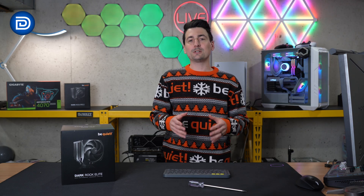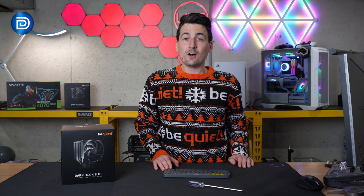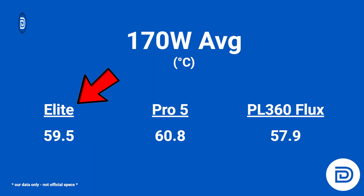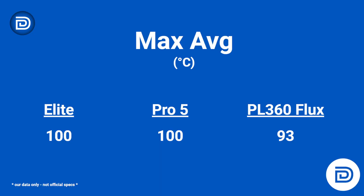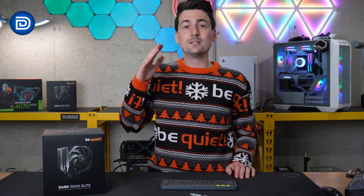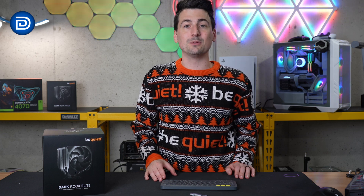Moving up to 120 watts: 50.1 compared to 50.2 for the Pro 5 — neck and neck — and 49.7 for the AIO. At 170 watts, very similar numbers: 59.5 compared to 60.8 for the Pro 5 and 57.9 for the AIO. And lastly, running everything wide open, the max average temp peaked at 100°C for both the Elite and the Pro 5, whereas the AIO peaked at 93 — and we're still not entirely sure why. Our understanding was it would run until that thermal temp was reached, but in this case the AIO came in seven degrees below the max.